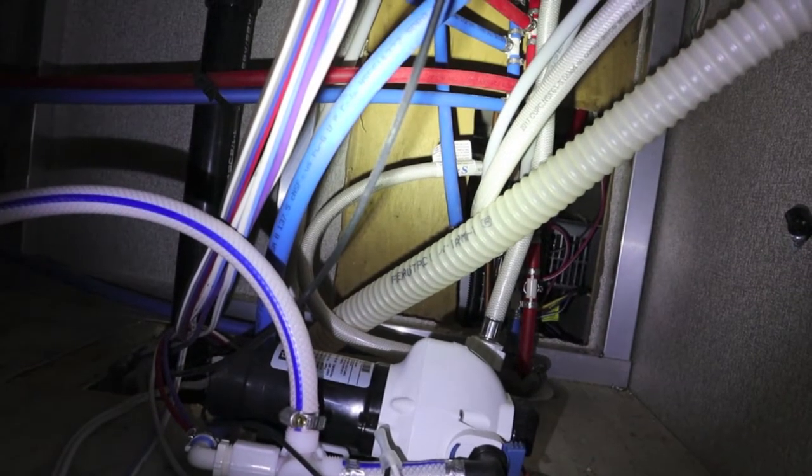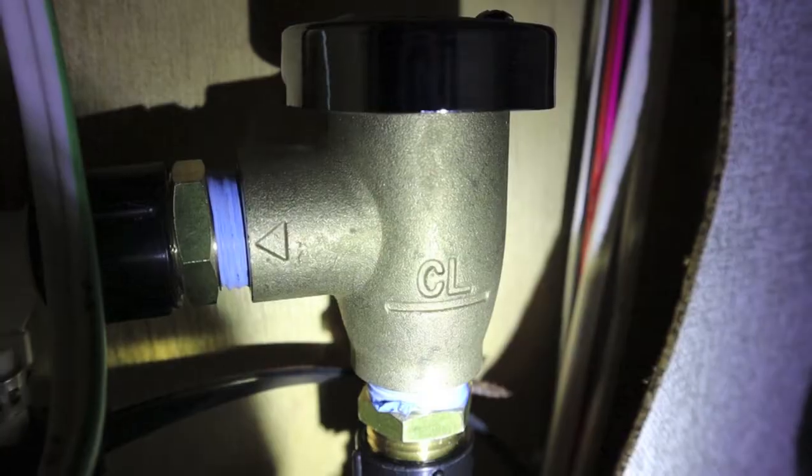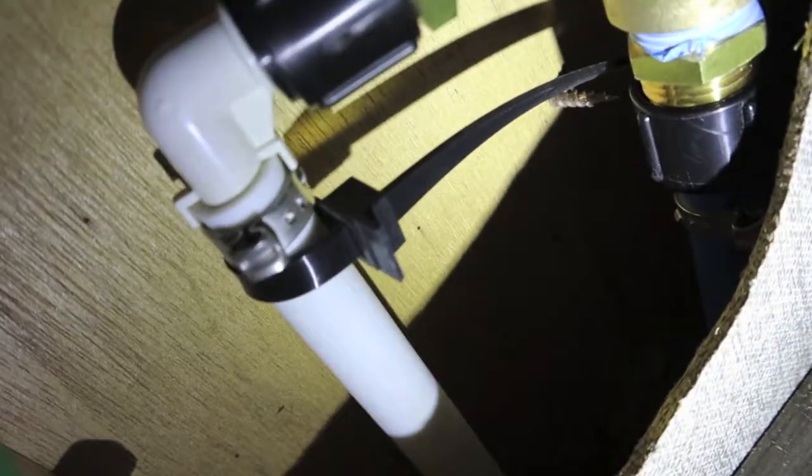Let's go upstairs and I'll show you what the Watts number 288 valve setup looks like. When you look in the bathroom I kind of started to panic because I thought I was going to have to cut a hole or take this panel out, because it was behind this wall. The reason I couldn't see it is my wife had towels — a solid wall of towels — and when I pushed them back I had this dandy little access plate right there, four screws. With the Watts unit you have to add the half-inch nipples; once you do that you're good to go. We already hooked up the black tank and did a test — she's bone dry. There's that blue line going vertical and then it's white going down — I kind of like the way they color coded that.